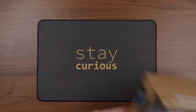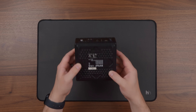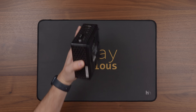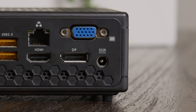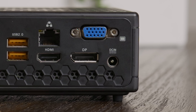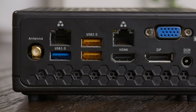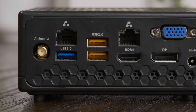One of the first things I noticed when I pulled this system out of the box was that while the outside of the case was plastic, it had a nice weight to it and felt solid — aside from what sounded like a loose screw rattling around on the inside. On the outside, the system has some pretty decent I/O. On the back there's a 5.5 by 2.1 millimeter DC jack for a 19-volt power supply, VGA, DisplayPort, and HDMI outputs, two USB 2.0 ports, a USB 3.0 port, those dual gigabit NICs, and a connector for a Wi-Fi antenna, which wasn't included in the one I bought.